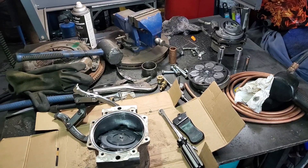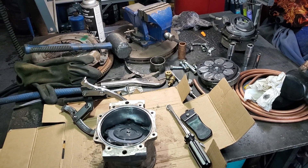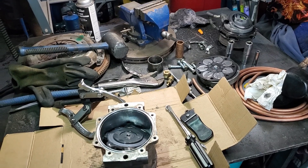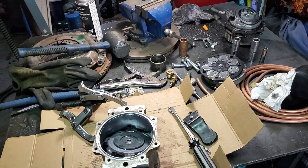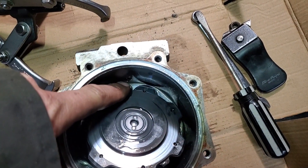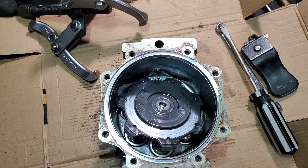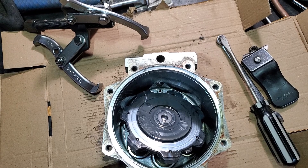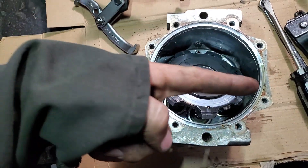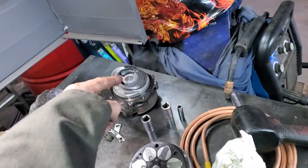For the Dodge air system update, I'm going to go with an AC compressor that I'm converting to an air compressor, since my truck doesn't have AC anyway but does have the bracket for it. I'm taking a Cummins AC compressor from an auto wrecker. I won't show the full conversion since there are plenty of videos linked in the description, but I will share one key tip: one video showed a guy who tapped a hole but didn't cover the other side, getting metal filings inside. My approach is to plug that hole first, then tap it, then blow the filings out the other side. Then I'll pack it with grease about a quarter full so there's always splash lubrication when the grease heats up and liquefies, and I'll grease the bearing as well.